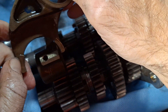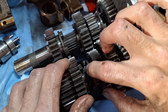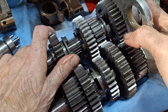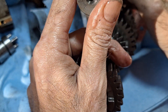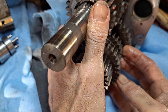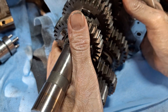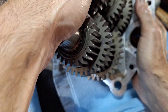We know that shift was screwed up. Since we know that's screwed up, let me look at the dog right there — it goes into a pocket. This is the dog right there. I'll have to pull the rest of these gears off. Bearings feel all right — bearings are good and tight. I'm just giving them a shake; there aren't any weird noises in the bearings.